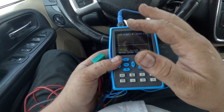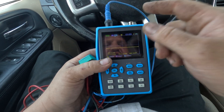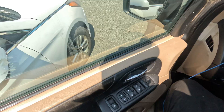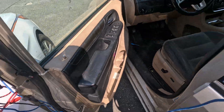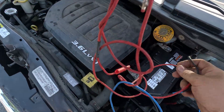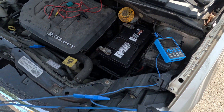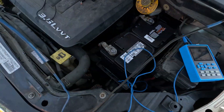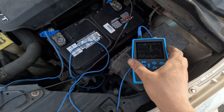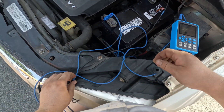I'm looking at the voltage because I don't have an amp clamp that's going to adapt to this easily. So we'll just hook this up to the battery — negative and positive. It's not showing 12 volts because we're on AC couple, so that's good. Now for the second channel...